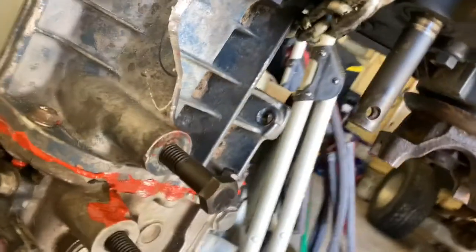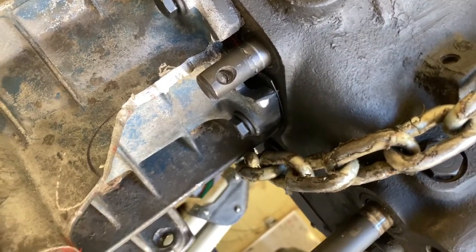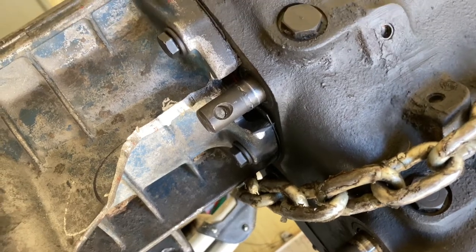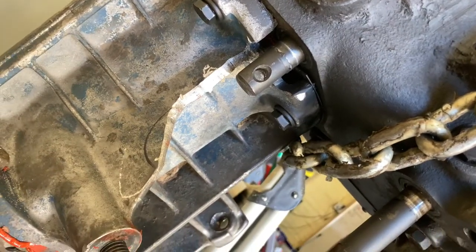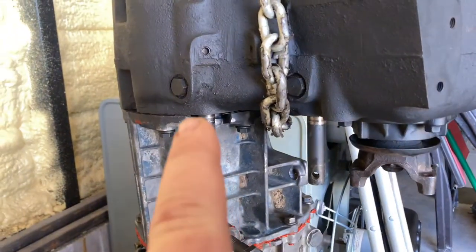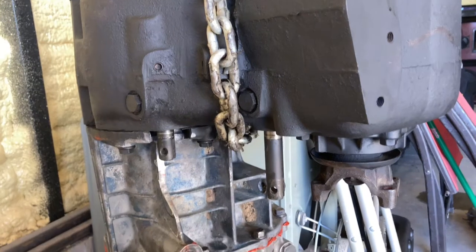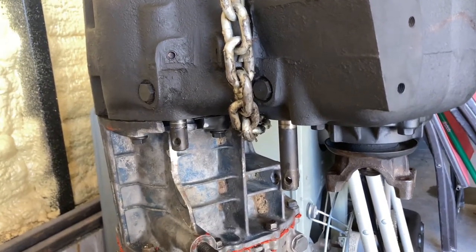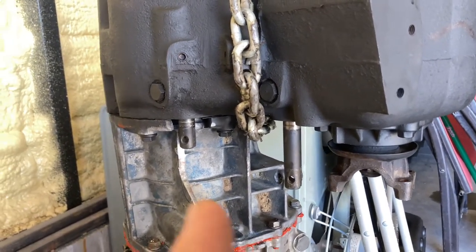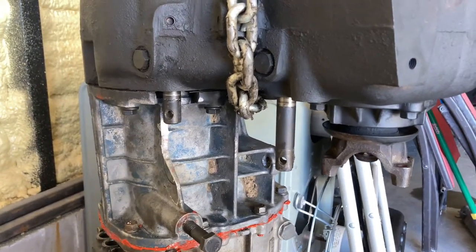You also have to clearance the back tail housing. I should have taken videos and pictures but I got excited. Somebody keeps messaging me about getting that shift fork in there. This one will be twin-sticked. I took that stick out and did the grinding mod on it — it was fairly easy actually. Now we have front high, front low, rear high, rear low, four high, four low.